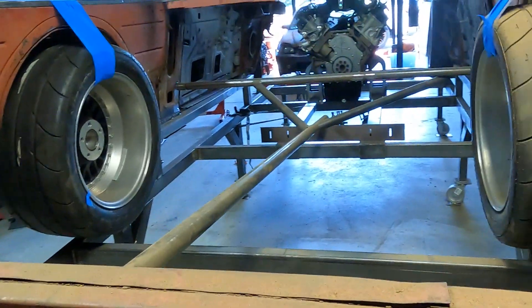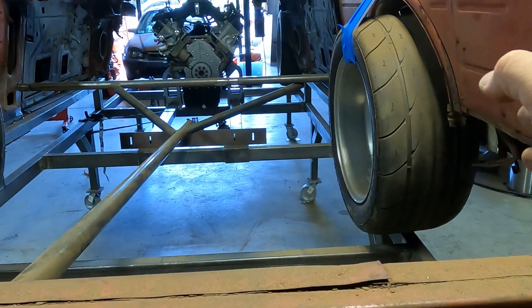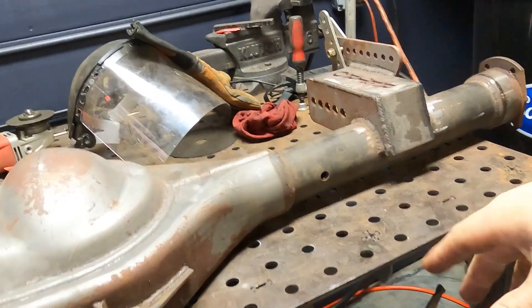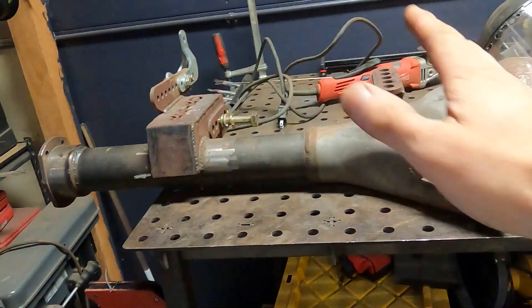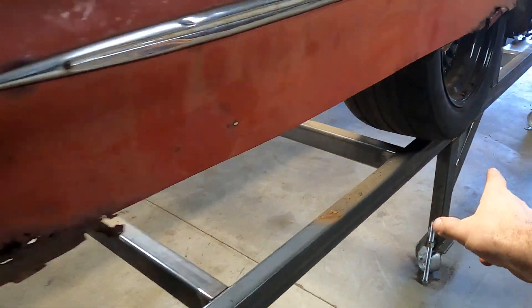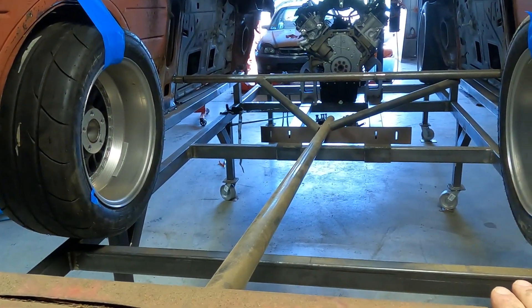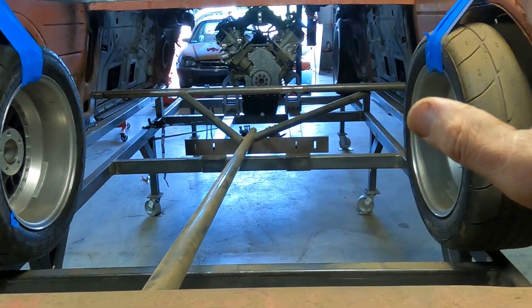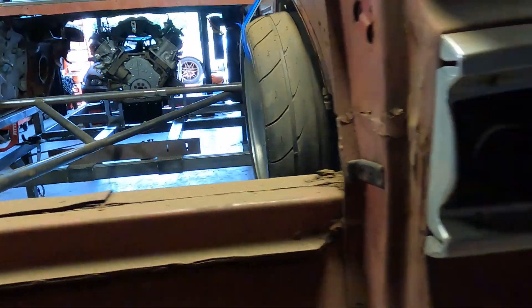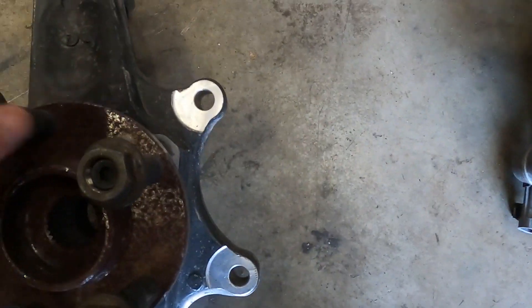Now that I have these wheels in here, I'm going to figure out the width for where I want to put the wheels adjacent to the body lines. The plan is to sever all this other stuff off, clean her up, and start fresh. I have a center section and I'm going to make a standoff - depending on where the wheels are - off my chassis table and hang the rear end itself. Then in this episode, we'll make the standoffs to hold my Corvette spindles.